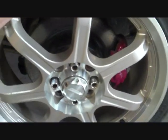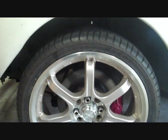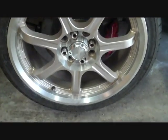But you don't want to do them too tight, otherwise you'll just wear the bearings out really quick and probably have a nice failure like I did. But they also should spin nice and freely, and with no grumbling or groaning, which is a sign that they're crying out for grease.